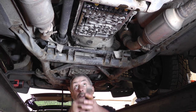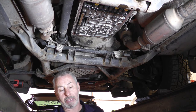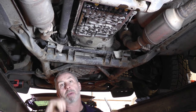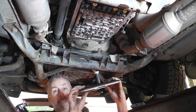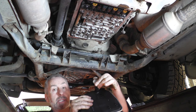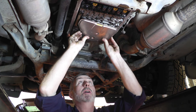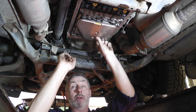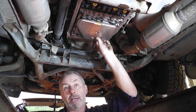But this is a nice simple one where we can show you exactly what to do. There are a couple more things we need to do before fitting the conversion kit — firstly, just make sure the mating surface where the gasket's going to go is nice and clean. The kit also comes with a new set of bolts to mount the sump to the gearbox, and they suggest you use an M6 tap to run up each of the threads in the bottom of the sump to make sure it's all nice and clean before fitting the new bolts. The filter is separate from the sump — remove the blanking plug from the end, then fit the filter up into the valve block. It pushes home nice and safely, with a couple of little clips that clip onto the pipework on the bottom of the valve block. Then with that in place, just put the sump back on — or if it's the restricted access one, slide it between the exhaust and the cross-member — fit it back on, put your bolts in, and tighten them up.